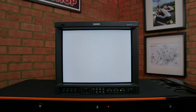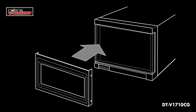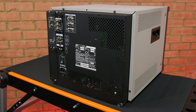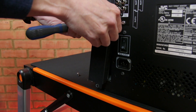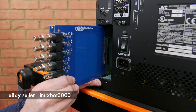This is a Sony Trinitron type technology which benefits from a brighter picture. It has 800 TV lines of horizontal resolution. It can be used as a 4x3 display or using a clip-on plastic bezel as a widescreen monitor. There are slots for three video interfaces. This monitor came with an SDI and HD-SDI card suitable for broadcast video, but not much use for me here at home. So I bought a third-party RGB and component card from eBay for around £80 including import duty.